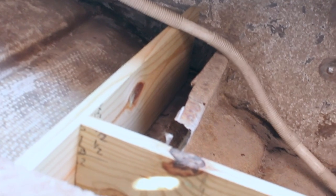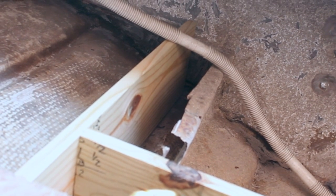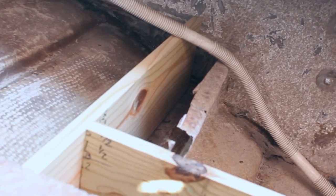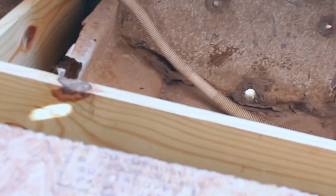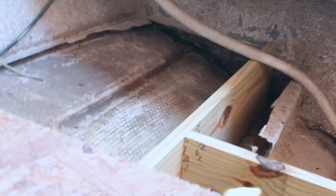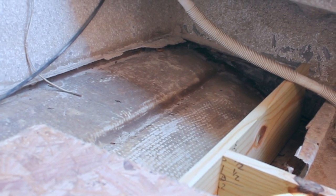I'm just going to add another piece of wood across the transom to support it and probably throw a couple smaller screws in there to bite enough of the fiberglass of the original transom. And I'm going to fiberglass it up pretty good, so I'm going to totally rebuild this whole bilge area back here from one corner to the other. Cut all the old fiberglass off the edges close to the hull itself, and my floorboard should fit on there nicely. But like I said, I think I'm going to slide a piece of one-by or something, probably some scraps from the stringer, up in the corners to support the edges of the floorboards.